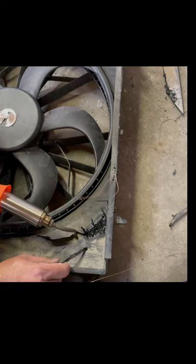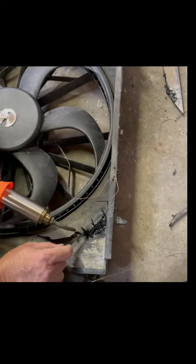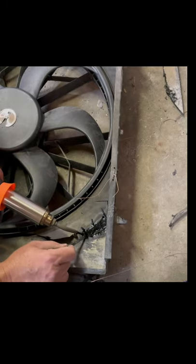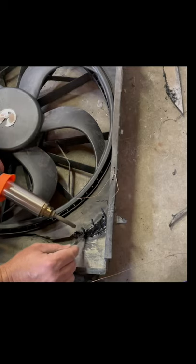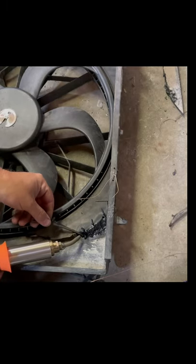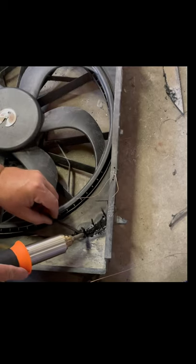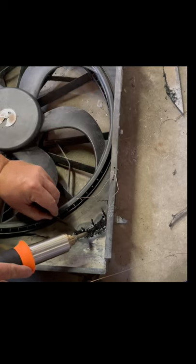I started on the inside that you're not going to see — the inside of the fan is going to be facing the radiator. Got a brand new radiator coming in. This screw mounts the fan, so I kind of cut around it before I even thought about plastic welding this. I could probably turn the air down a little bit — it says 4 or 5 PSI but my regulator is in 5-pound increments, so it's probably a little high. But that's okay, it's helping me smooth it out.